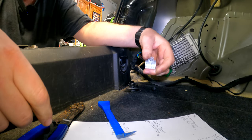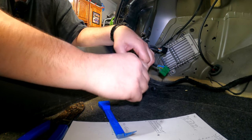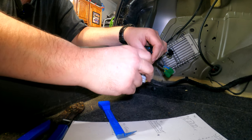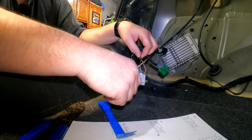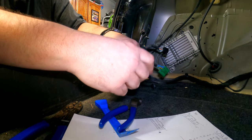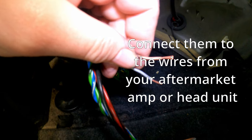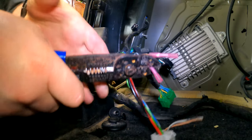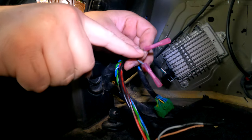On this first plug — this is the X1 plug — it has eight wires, but really there are only two wires I'm going to cut on here. They're the ones at pin number one and number five: the gray and tan wires. They're the left front outputs — the positive and negative speaker wires. So we're going to cut these off back here, strip them, and set that aside. Those wires are cut, and I'm just going to tape the amp-side ends off and let them hang, because I'm totally bypassing the amp. I'll take the wires going to the speaker, strip them back, put a butt connector on this side, crimp it down, and then use heat to shrink these ends down onto the wire to give us a nice waterproof seal.